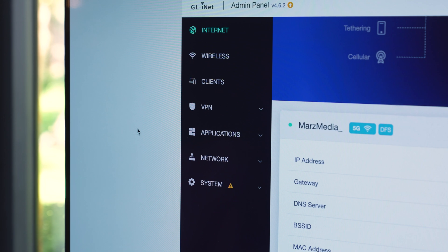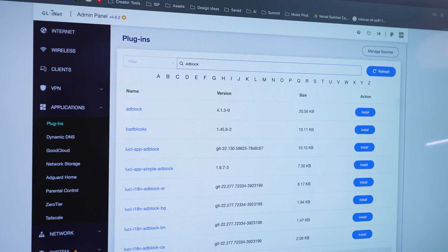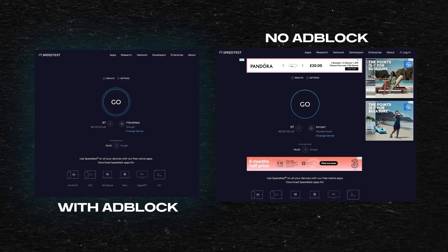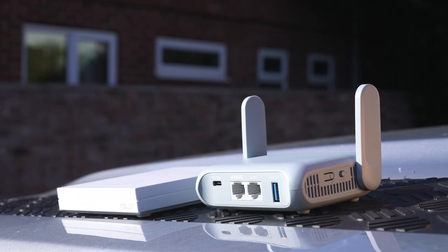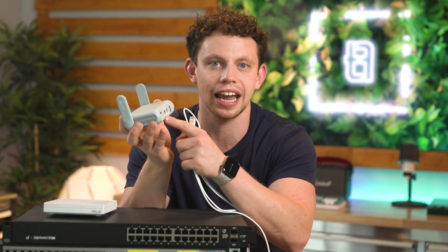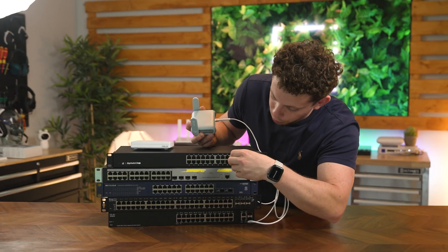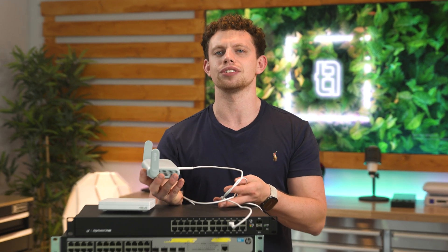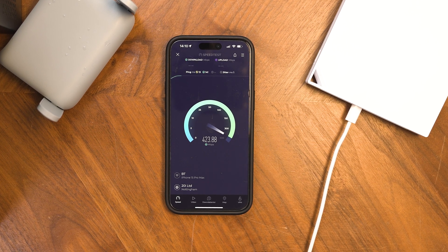The fact this is all being powered off the USB from my Tesla blows my mind. The GLiNet device specifically, if used in router mode, has the option to install certain packages. For a quick demonstration, you can install a router-level adblock, meaning every device that connects to your network has adblock already enabled. And it goes without saying — all of the features I've shown today are obviously achievable, but if you wanted, this thing could just be your router. You could feed it a WAN connection over ethernet, plug in a LAN connection, and build out your home network with an ethernet switch and wireless access points. I don't know why these things are called travel routers because they're basically just baby routers with loads of features at a decent price.